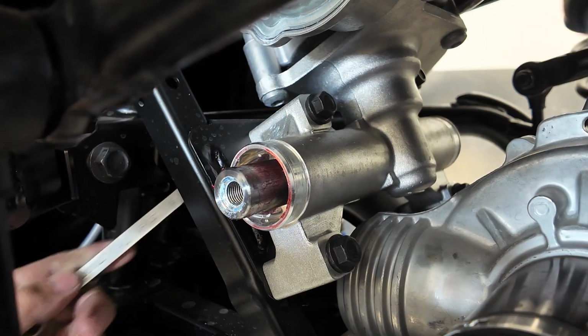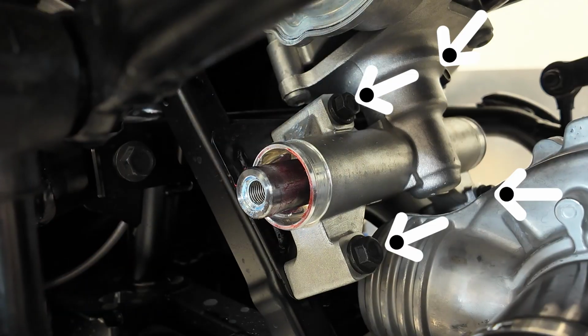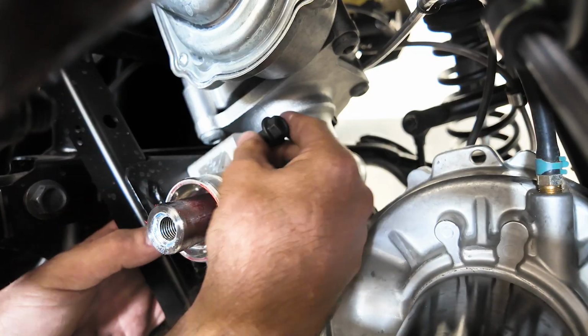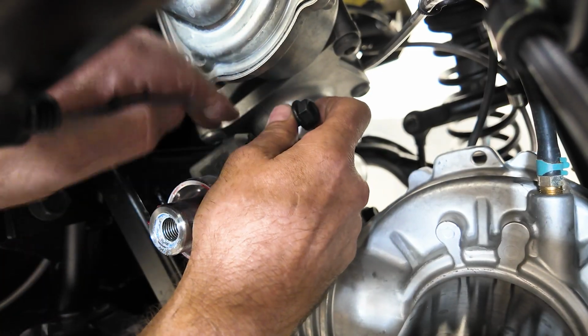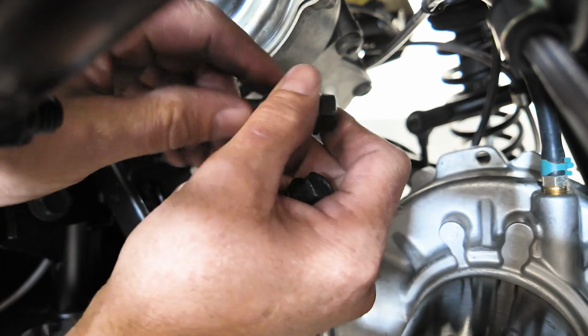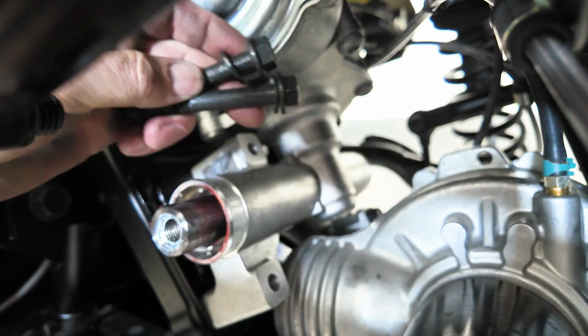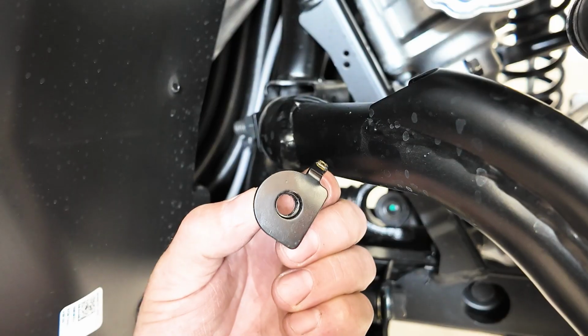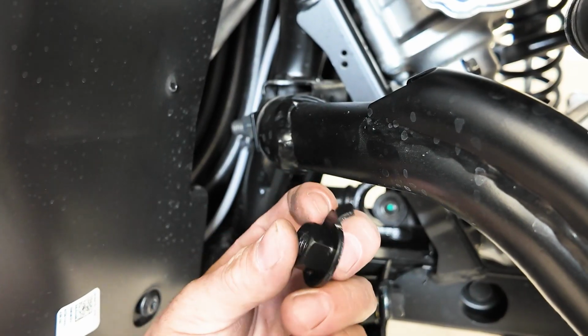Once the tie rods are removed, now we're going to go ahead and remove the 4 mounting bolts for the steering rack. We do not need to disconnect any electrical or sector shaft joints at all. The rack will stay in place, just the 4 mounting. On the passenger side lower of the Xpedition is a modified weld nut that has a chassis tang to hold it in place.